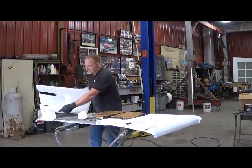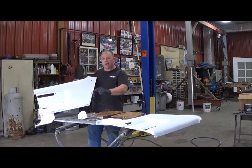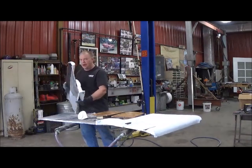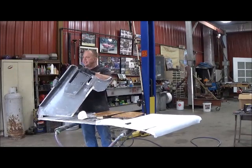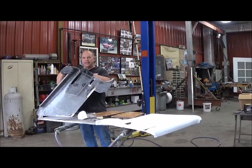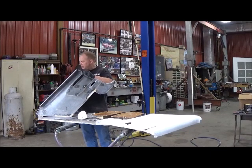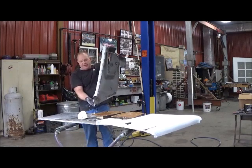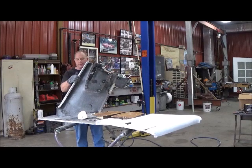I had to add a little fiberglass material there and there, and shaped it around the framing for the back seat. And I'll put all this in there and show you in a second. I'll put in a 16 gauge metal here. It's riveted and weld bond, two-part weld bond adhesive with rivets, and then finish that out. That way I have a good strong place for your arm, or somebody pushes on it, and the piece of felt that goes through here.